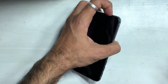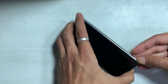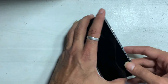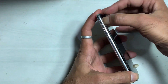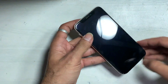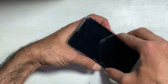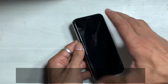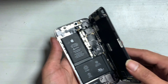For Face ID, be aware that after changing the LCD, Face ID may stop working. Do not touch the dot projector while the battery is in a connected state — that may damage your Face ID forever. Many don't know that a simple touch on the dot projector can cause damage due to static energy produced by our body.